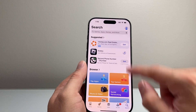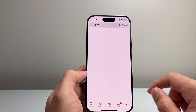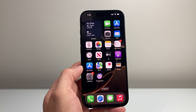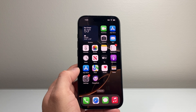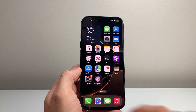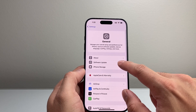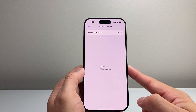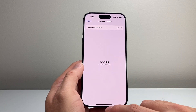Go back and search for the app that wasn't working before — for example, CapCut — and reinstall it from the list. That's another way to fix it. If it's still not being fixed, go to Settings, then General, then Software Update, and check if there's an update available. Sometimes a new iOS update might fix an issue that was causing the speakers not to work, so update your phone to the latest version.